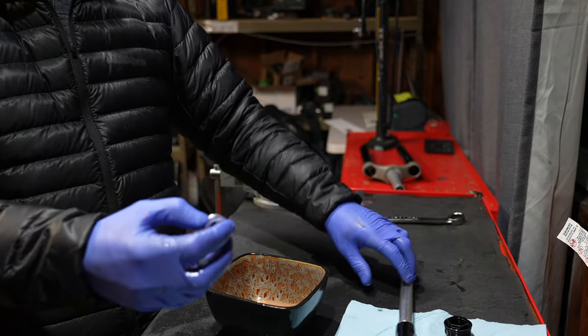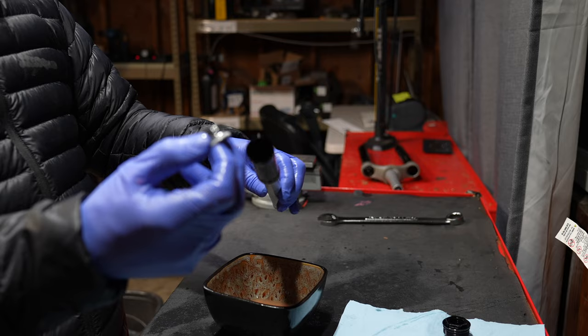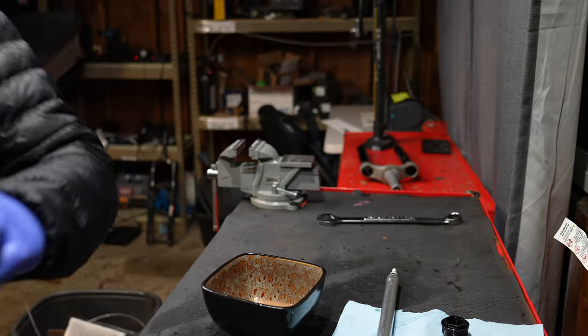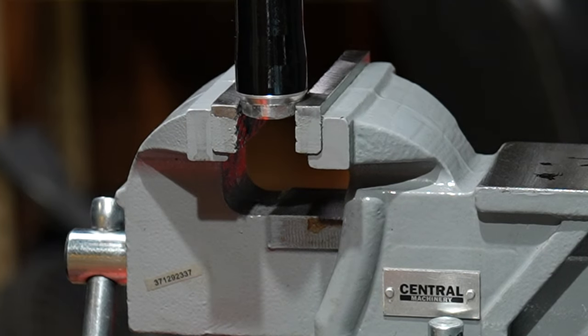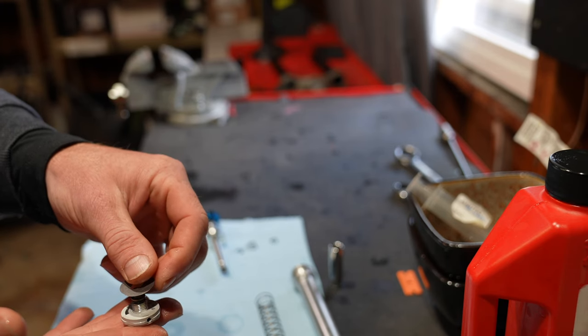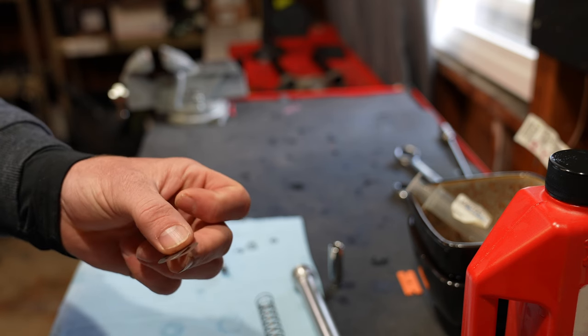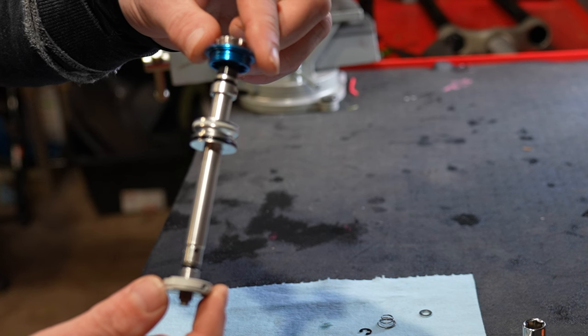The compression cartridge is basically ready for new oil. If you want the whole explanation of the less than ideal compression damping in the RC2 damper, keep watching. To access the base valves and change the shim stacks, unscrew the chrome piece — I was able to do it with a strap wrench around the black section. The base valve has two paper thin washers on top of it.